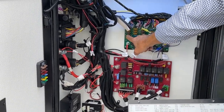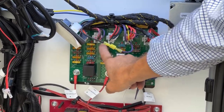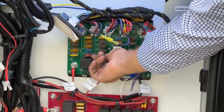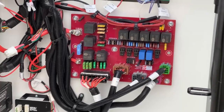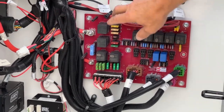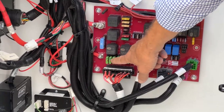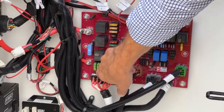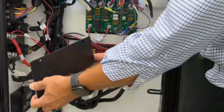On the upper panel, there is an additional LED light beside each fuse. If you see any of these that are red, that's an indication that that fuse is blown. If that happens, just pull the fuse out, put the new one in, and the red light should go out. Some of the fuses are resettable. Some of them are breakers that automatically reset themselves. If it's a resettable fuse, you can reset them. These fuses at the base are the ones that are resettable — if they trip, there's a small plunger that will come out that you can press back in to reset. Once you're finished checking all the fuses or replacing, just put your panel back in place.